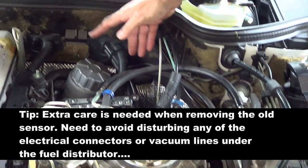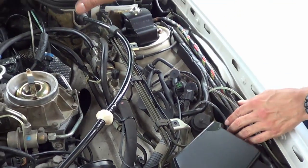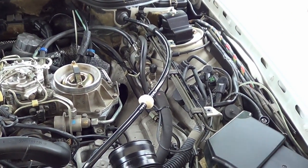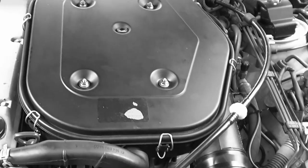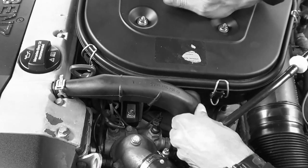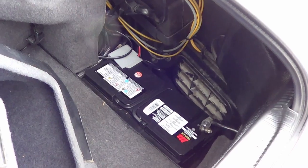For the old one, what I think I'm going to do is snip it where the actual sensor was and then fish this wire completely out. But before we even do that, let's leave the new one still in play here. Let's put the air filter back on, put everything back to normal. Don't forget your engine intake air temperature sensor — close it nicely — and your air filter as well. Make sure your breather hose is connected. Before we take it for its first ride, we're going to disconnect the negative battery to try to reset everything.